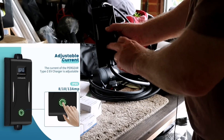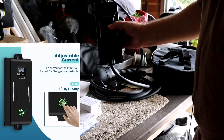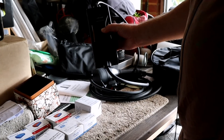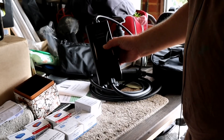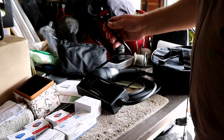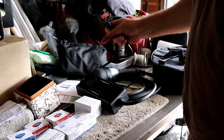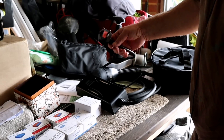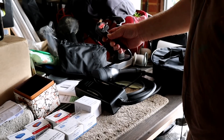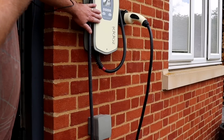To ensure safety, always get one that has a button to reduce the power. This one can change down from 13 amps to 10 amps and all the way down to 8 amps — that's 1.7 kilowatts. The lower the power, the slower the charge, but the less heat on the box, the plug, and the socket. When I use a granny charger I always set it to the lowest possible power, because normally I'm at a destination and I don't mind how many hours it takes.